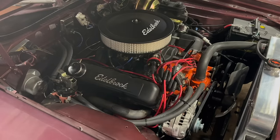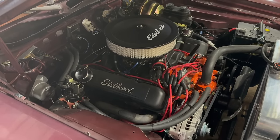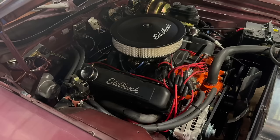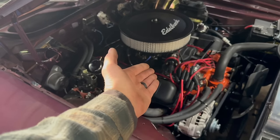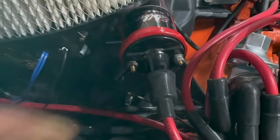A quick but important note on tuning. Before you attempt anything like this, make sure you've got a full complement of happy cylinders. You know, 8 reasonably fresh plugs. All your plug wires are connected. Your cap and rotor are in good shape. Your coil's not oozing fluid everywhere. Gee, Jamie, maybe that's part of your problem. We'll deal with that later.